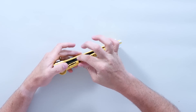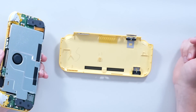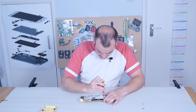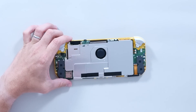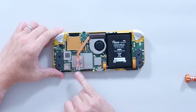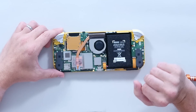There we go — it just needs to be lifted, sort of that lip over the headphone socket, which is nice that they still include. There's the handwritten signing on the inside of the unit. Still a lot of assembly has gone into the inside of this. We start by removing the RF shield, or heatsink — we'll find out when we get inside. It still retains the active fan, so the lower power dissipation of the upgraded main CPU is not great enough to revert to passive cooling. There's a nice little heat pipe from the main CPU system-on-chip. That's 4GB of RAM — same as the original. Nice little heatsink fan. And the battery is nicely vibration-mounted.